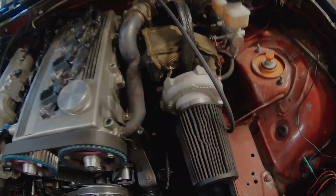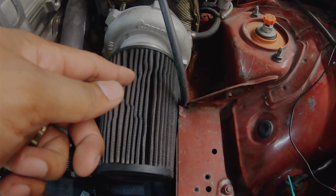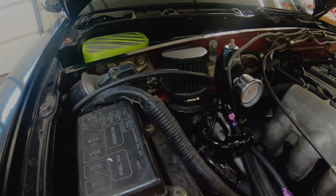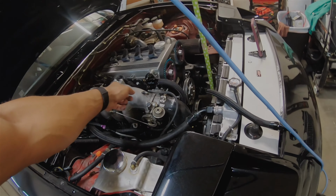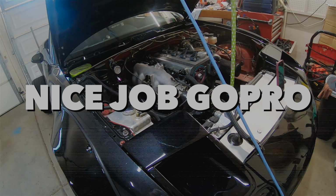All right, so next thing, now that that is done and out of the way, we're gonna try and put this intake on and get that set up to where it's sucking in air here instead of just over here, because it seems like the system is being overpressurized and the catch can itself is not catching everything. Well, it's catching everything, but it's definitely letting blow by. You can see it coming through, so we're just gonna suck that back up. It's probably because all this stuff is the way it is. So we're gonna try and fix it. We're gonna try and reuse this line.